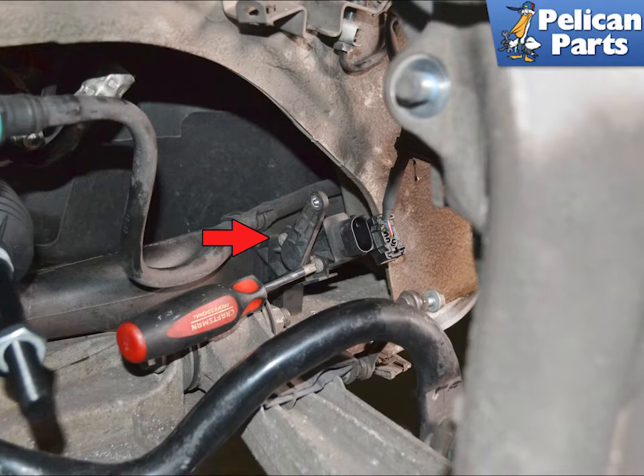After the angle sensor has been replaced, the front end control unit must be calibrated. Afterwards, the headlight setting must be checked and adjusted if necessary. Connect your scan tool and turn the ignition on. Find the front end control unit and carry out the calibration menu, then check your headlights and adjust as needed.